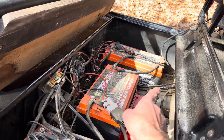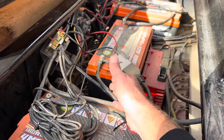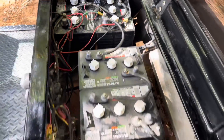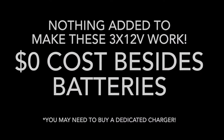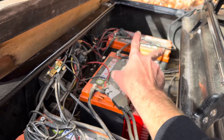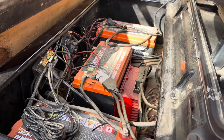I've got a breaker over there to disconnect the XRH from these. These are just wired up with the original lead-acid configuration — it's just three batteries instead of six 6-volt batteries. Same wiring, same setup as it was. Just like the original lead-acids, the 12-volt accessories are just taken off of a 12-volt tap. I didn't put a converter in — just down and dirty, a 12-volt battery swap for this golf cart.